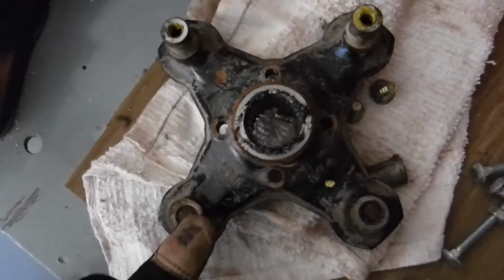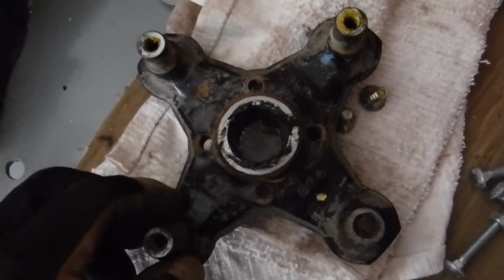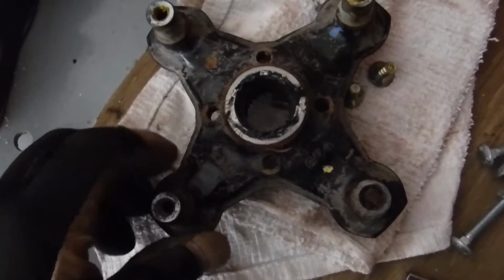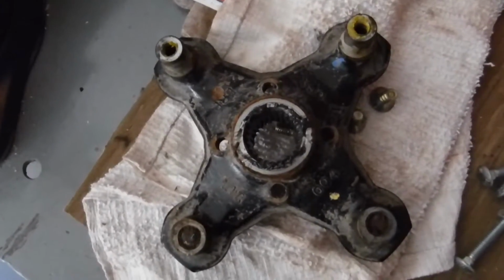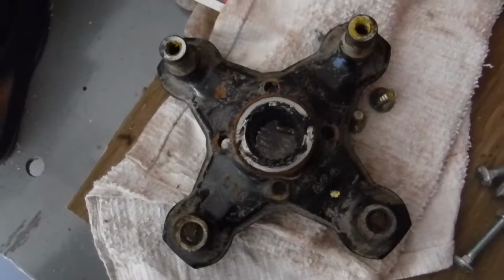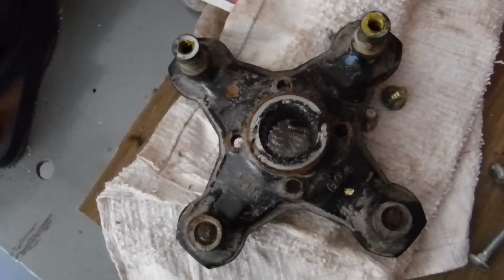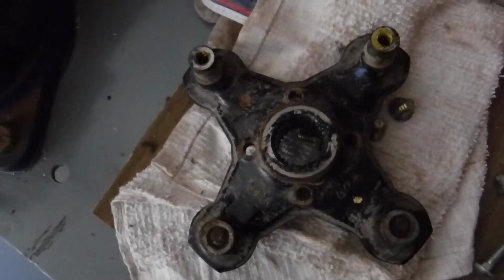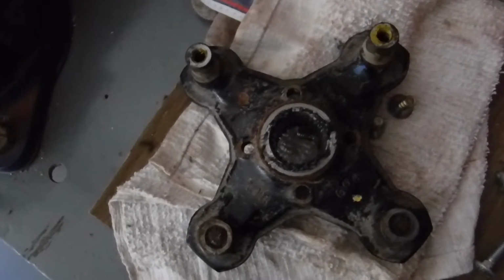Right, you can see a little better. Stud snapped off, stud snapped off. That's the end of it, just like those. And I don't know what would cause that. I torqued to the specified 74 foot-pounds, but 74 foot-pounds sure seems like an awful lot. Seems like more than necessary. They're almost impossible to take the wheel nuts off once they're torqued to that by a wrench or a ratchet. So trying to take them off in the field would be impossible. So something's wrong with that.